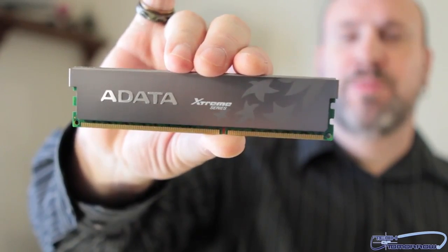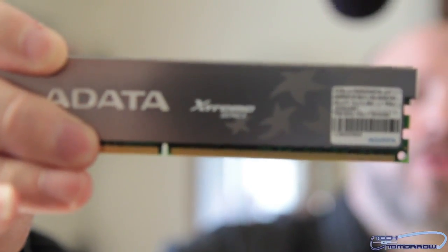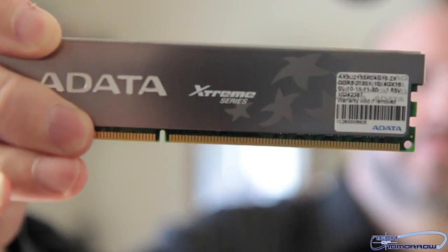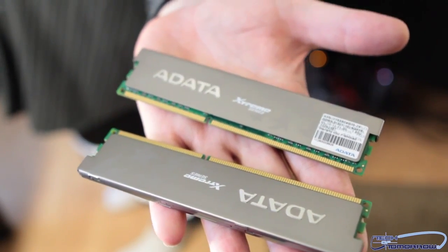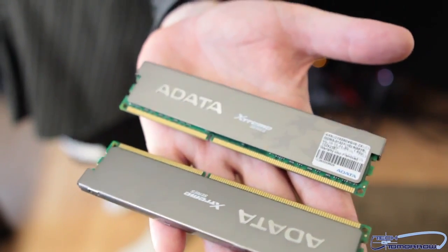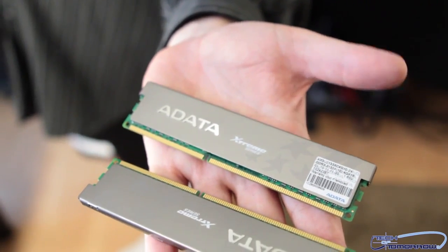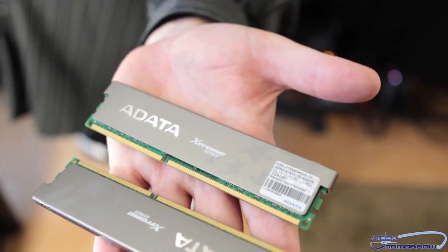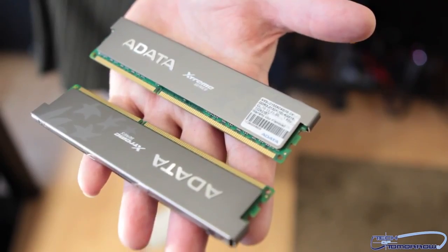We dedicate these to the Olympic people out there — hope they get some gold medals. Now as we bring this up you guys can see the nomenclature on the back, and here's the other stick just for shots and giggles. That's pretty much it, guys — it's memory, you know what it does. Stick it in, go into your BIOS, set the XMP profile and away you go. If you just set it to 2133 it will overclock your system, so keep that in mind — make sure you set the XMP profile.